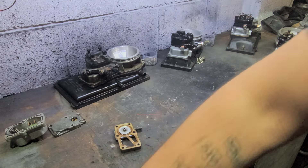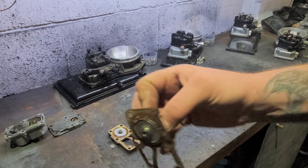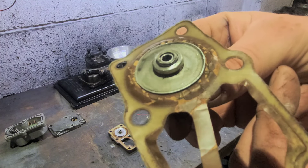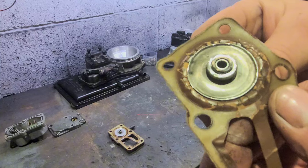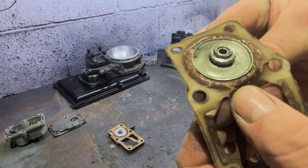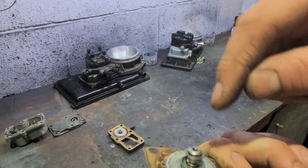So we've got our kit. This is the diaphragm out of the old one — as you can see, it's absolutely shot. If you can see closely, where all the cracks are, you've got the lighter brown which is the structure of the membrane, and the flaky bit on top. The air will get through that light brown material — the dark brown stuff the air won't get through. Once you get this apart it will come apart if it's broken. What you want to do is remove the centre adjuster — we need that. Get your allen key and unscrew it. These are very, very fine threads so we don't want to damage them.